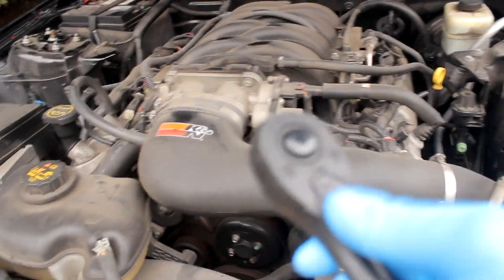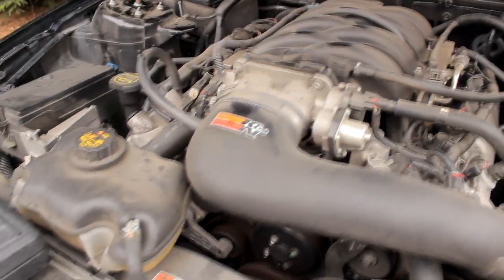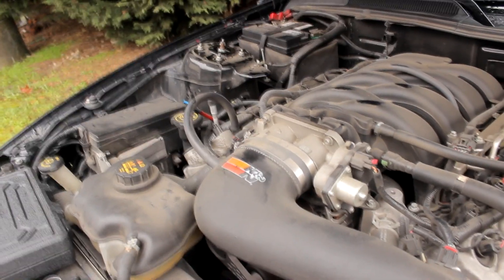All you're going to need to do is take your intake off, either get your half-inch ratchet or a wrench, stick it in the tensioner, push down, and that's it. It's a really quick install, so I'm going to take off my intake to make it a little easier to see.